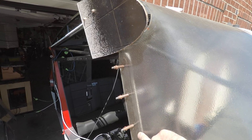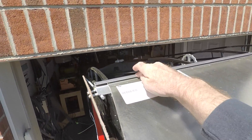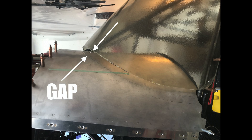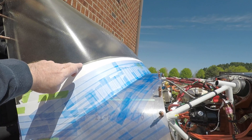Here's the plan. I've got the windshield pinned to the tabs along the B station pillar, and the windshield is tucked all the way into the back of the channel. That created an even bigger gap at the bottom than I thought. That made me rethink whether I really want to do this — it's going to be $650 to replace that windscreen — or can I do this in a way that makes it safe, functional, and practical? I think there's a good workaround.